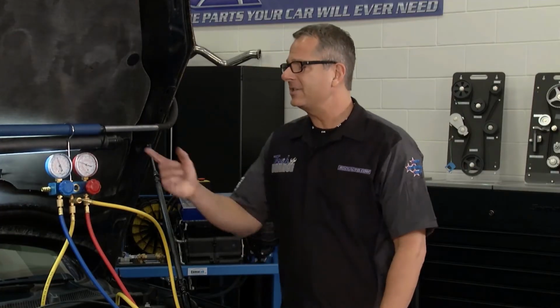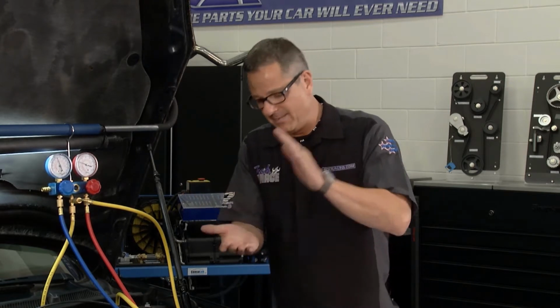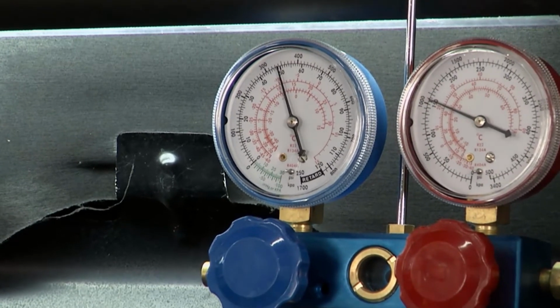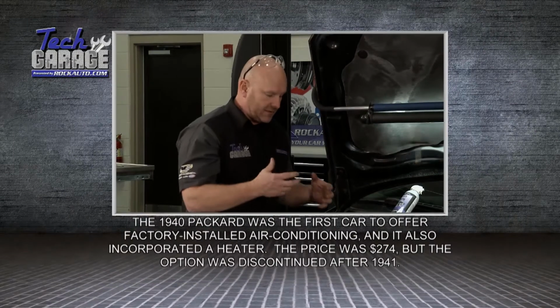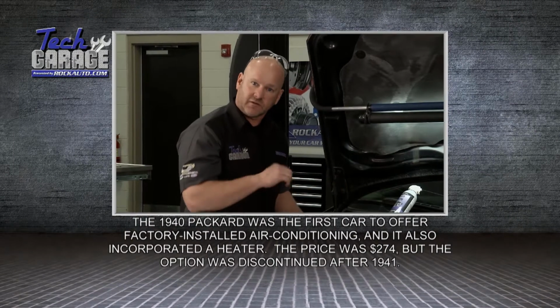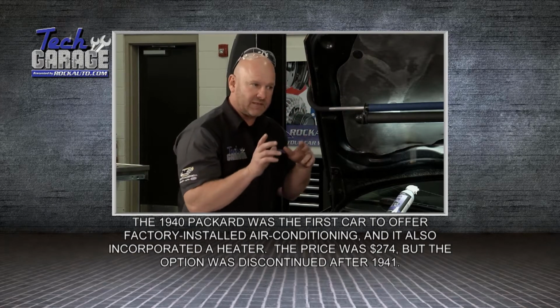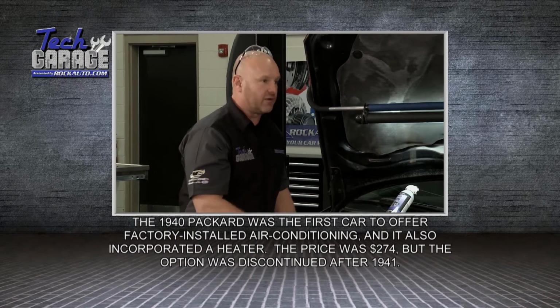That should drop just a little bit because you froze the top of that TXV. When you do that, bam, it should go closed, and the compressor should pull the low side into a vacuum. So I'm suspecting a bad TXV valve. That's the one place in the system where there could be some kind of restriction, a bottleneck. Interestingly, John didn't complain of a belt squeal or strange sounds from the compressor when he turned it on to max AC. So even though the gauges could suggest a compressor, it doesn't really look like it at this point, but we need to prove that.